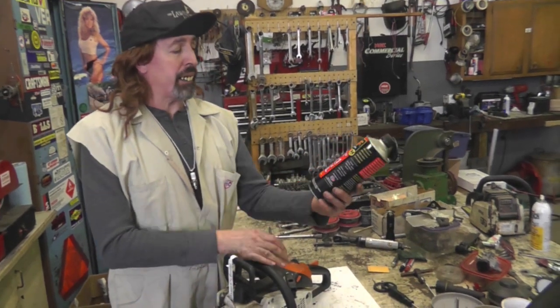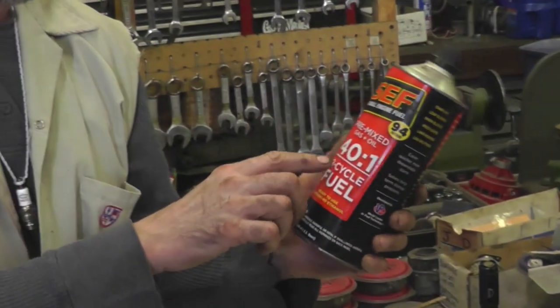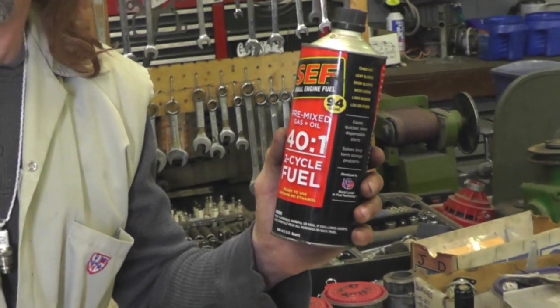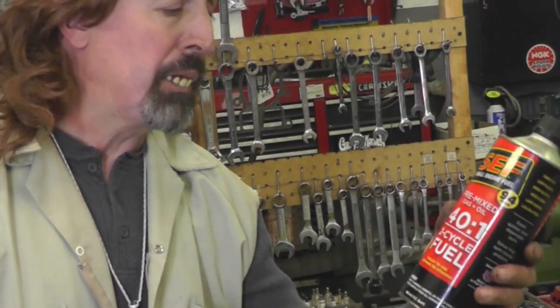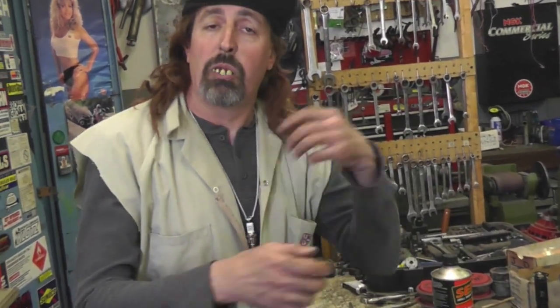You can buy this product — they make it under a bunch of different names. This is 94 octane, it's already premixed two-cycle oil, and it has no ethanol in it. That alcohol will work against two-cycle oil and will also make the chainsaw run real hot. This has got a real long storage life. So if you're the kind of guy that doesn't use the chainsaw very much, you might want to buy this — about eight, nine dollars a quart. It'll make your saw start easier and run better when stored for long periods. If you do store your saw for long periods, dump out the gas, then mix up a fresh batch of two-cycle oil and put it in there. And always leave fuel in it — don't dump it out and run it dry. That alcohol will dry everything up inside the chainsaw.